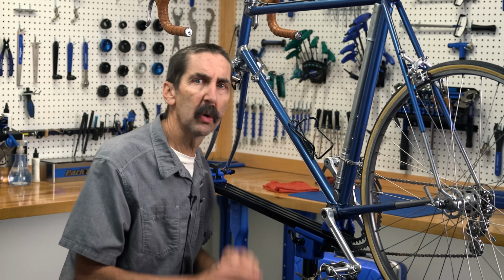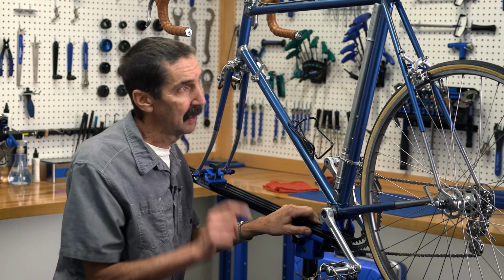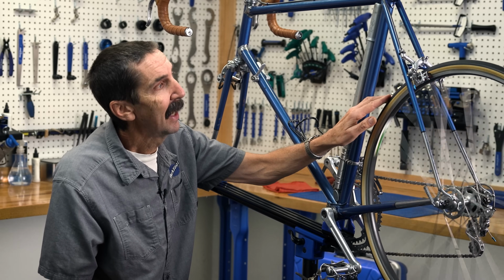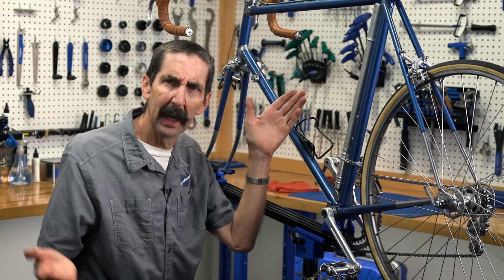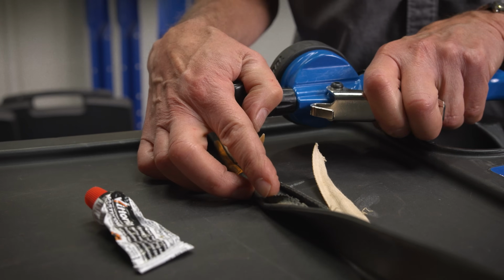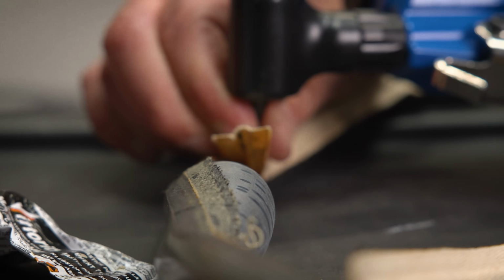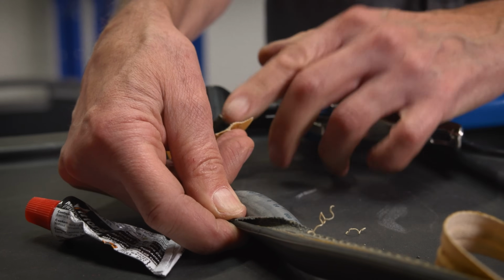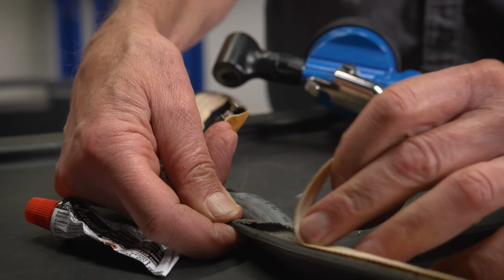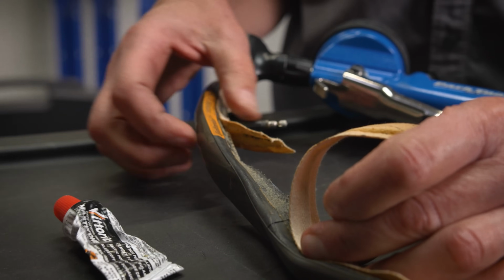We are so close to getting this bike back to race-ready conditions. But first, baby needs some new shoes, as in tubular tires. What are tubular tires? Tire casing without a bead is sewn around the inner tube. The stitching is protected by the base tape. We glue the whole thing to the rim with polymer glue called rim cement. It's an old system that's still being raced, so let's get an idea of how it goes.